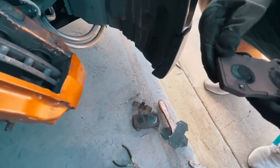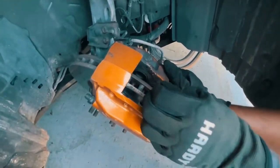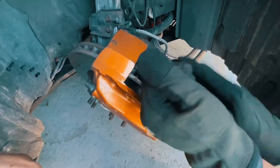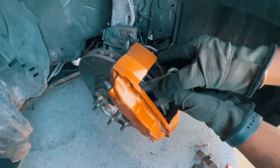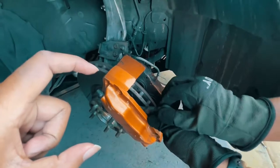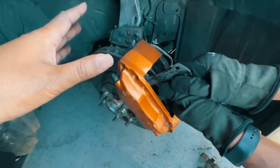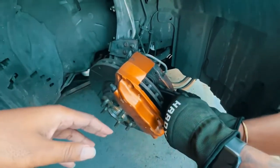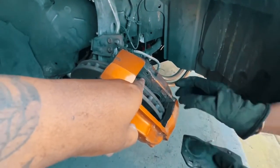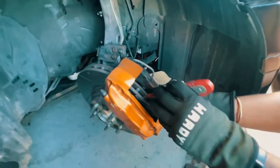That's how it's supposed to look, right? Okay. So now what you do is go like this and push the piston back. Go with the flat side first, try to get a good piece inside there and do it slowly — apply it slowly. The whole key to this is pushing the piston back. I'm glad I got my brother here to show y'all because I don't claim to be a mechanic — I just know certain things. I would have been taking off the whole damn caliper. Remember, those are super easy. See how the piston is being pushed back — it's a two-piston system. You just push the pistons back to create the space you need.